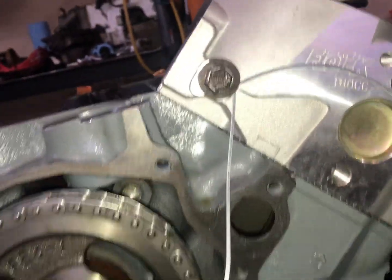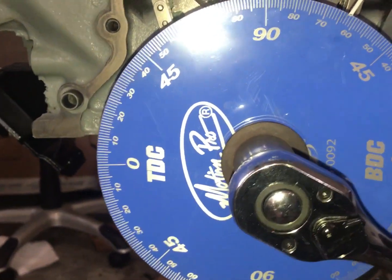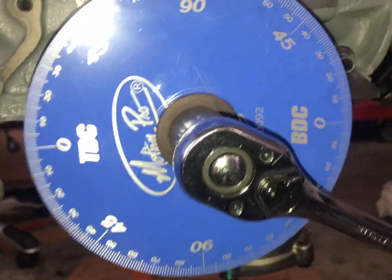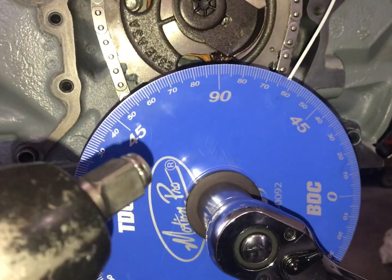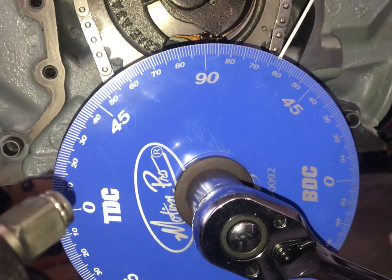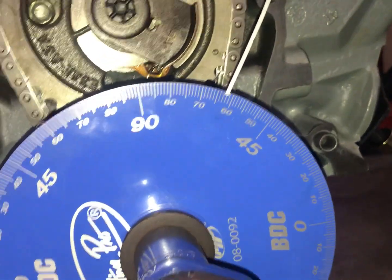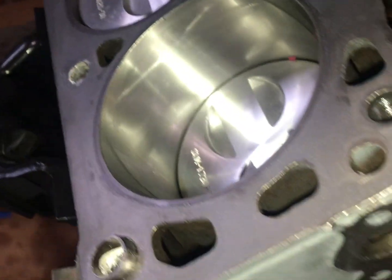You can see I've got my coat hanger pointer set up here with about the cheapest timing wheel I could find on Amazon — I think it was actually from a motorcycle company, but I drilled the hole out and it works. We used an air wrench. A lot of times the degree wheel will move on you if you're just using the balancer bolt on the crank, so what we did is move the degree wheel back about five degrees from top dead center when we set it up. When we tightened it, it moved about five degrees and we stopped just after, then moved the pointer so it was still set at top dead center. We also used our dial indicator to set top dead center on the piston itself.